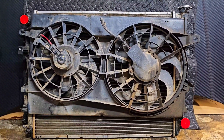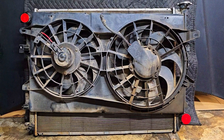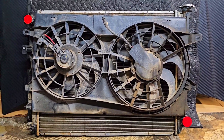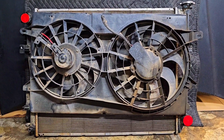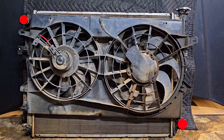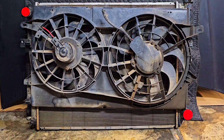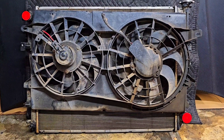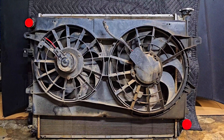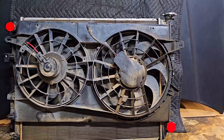However, from what I've heard from many people that have installed them, they do have a lot of amp draw to the point where you're going to have to run a bigger alternator. With these Ford fans, since they come in a stock vehicle from factory, there is a video — I'll leave a link in the description — where somebody does the amp draw test of each individual fan. On startup there's a quick spike of 60 amps on both the small and large, and they both steady out within one second at around 18 to 25 amps. A couple of people usually run 30-amp fuses with these or 60-amp relays.